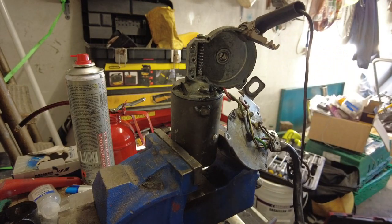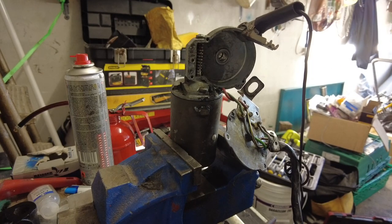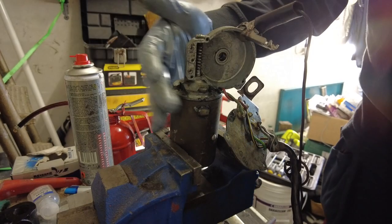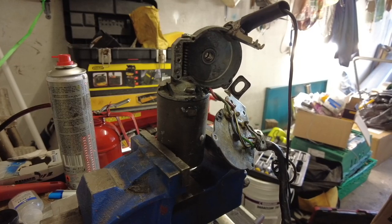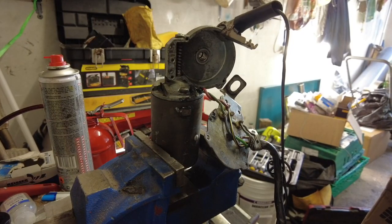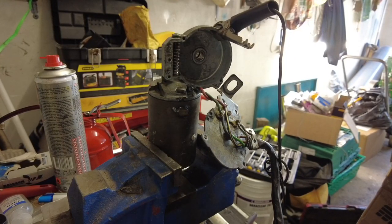That's great — I'm happy with that now. We're finished with the motor side of things, thanks be to God, because that was a bit of a faff. Simply because there were three brushes — the reason there's three brushes is because there's two speeds on the motor. Incidentally, the starter motor in the Beetle was also not working at all — turning very slowly — and one of the brush retainers had actually pushed back. I was able to relocate it, reshape it a little bit with the pliers, click it back into place, and it seems fine now.